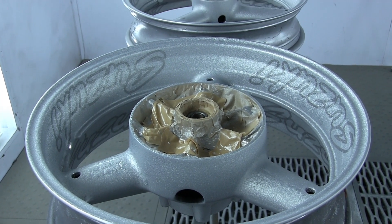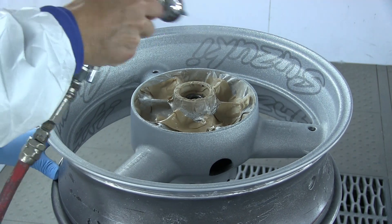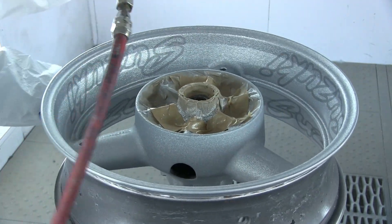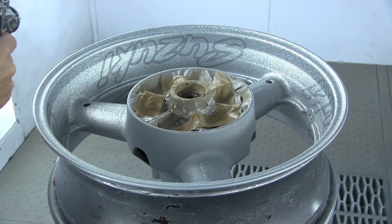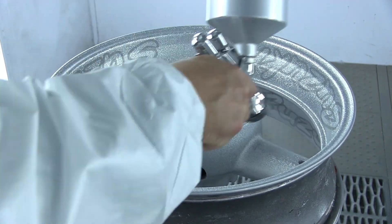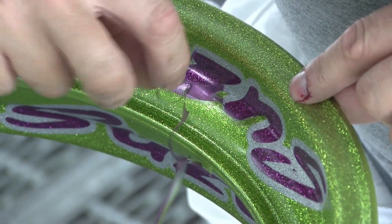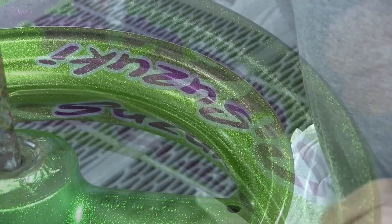Now I'm going to lay down my graphics — in this case the Suzuki graphics. I've just cut them out on the plotter, applied them, and before I lay down the candy I'm going to put one coat of Autoborn Sealer 6000 — it's a clear sealer. What it does is give the candy a beautiful surface to grip to. I could just spray candy straight on top of sanded clear, but this is like putting a little bit of grit on the road — the candy's going to behave itself better. It's also going to seal up the edges of my graphics and stop any candy getting underneath, so when I take off the vinyl or tape, I get super sharp, crisp, clean edges.